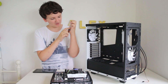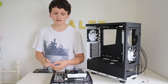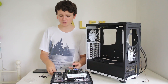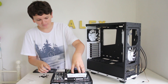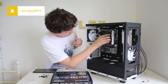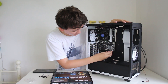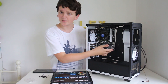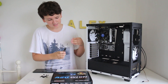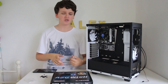You'll find a bag of 6-32 screws — these are the ones you're going to use for your drives, the power supply, and the motherboard. Get your screwdriver, get one of the screws ready — preferably use a magnetic screwdriver, otherwise it gets tricky. Hold the motherboard by the CPU cooler, be careful not to touch any solders or resistors on the board. Get the motherboard aligned with your I/O shield, then screw it into one of your standoffs — preferably on the bottom right-hand side first, since it's then supported by the I/O shield and case. Continue installing the rest of the screws and then your motherboard is fully installed.